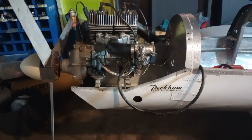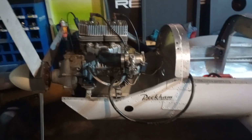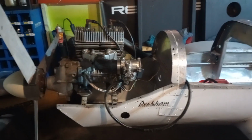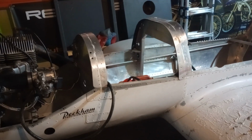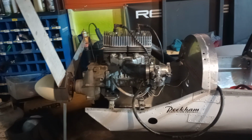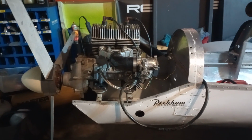But yeah, so I'm curious what the fine is for having just a titch too much fuel in it versus obviously the weight fine and other fines like that, to see if it's worth justifying having an extra safety margin. So you're allowed to have things for safety, right? Gray area, I know, but yeah, that'd be something I'm considering, is going slightly larger on the tank, have say 7 gallons, so I could effectively have 2 hours of flight time. Obviously, this is relative to how wide open that throttle is and how much throttle is required to cruise, but I'm expecting it to drink through about 3 gallons per hour.